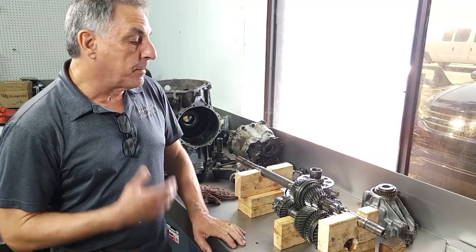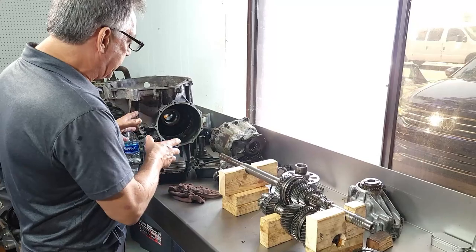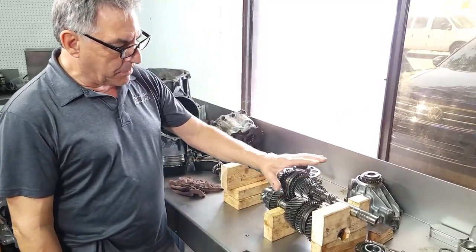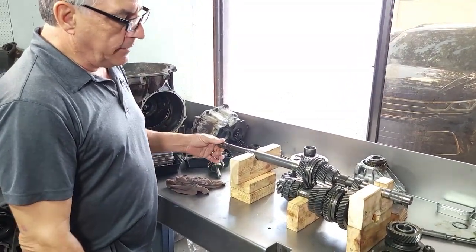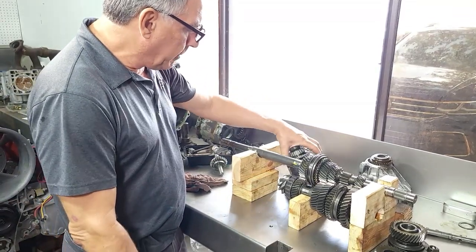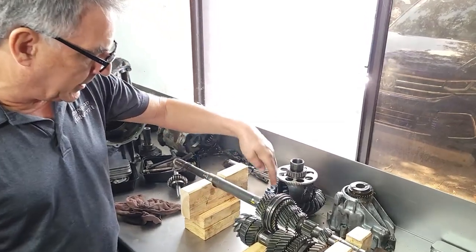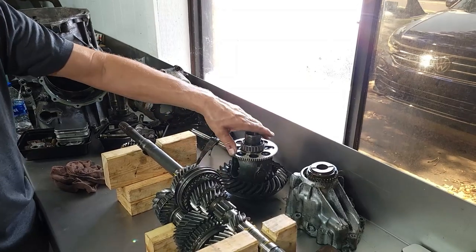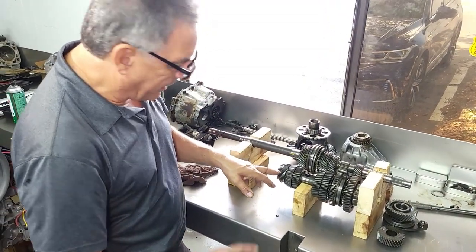When it's all inside the case you really can't see what's going on — it just looks like a mess. But when you break it down we have our input shaft. The torque tube connects directly to this from the engine and just rotates it. With the engine running, this is all it does when you're in neutral. This won't move because it's attached to the wheels via the ring gear — this is why we call it a ring and pinion. This uses a 12 millimeter offset; the gear isn't directly dead center, it's off center by 12 millimeters for strength and quiet operation. There's also a certain depth that this is sunken into the ring gear.